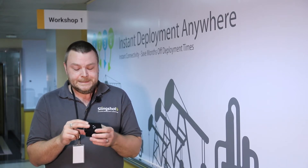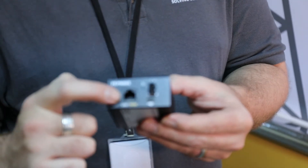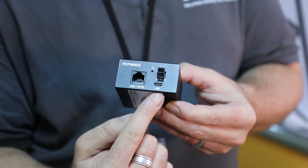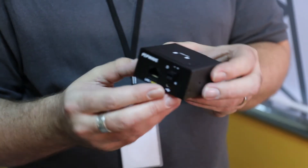And it does that with two internal LTE modems providing cellular connectivity, as well as the ability to add a fixed line internet connection via the WAN or LAN port at the front here. It also has a USB connection, and this enables the direct connection to a computer, presenting this as its internet gateway.